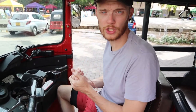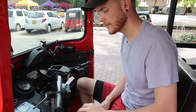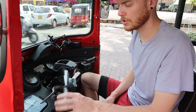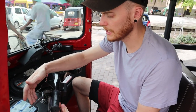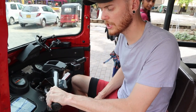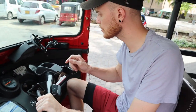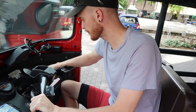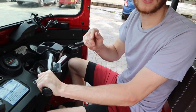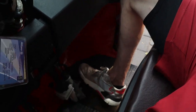Now we've got it started — you're in neutral. How to find the gears: this here is the gears and the clutch, everything is on this lever. This lever here is the clutch. Now we're going to go into first gear — pull the clutch in and click it up. Now we're in first, the neutral light will go out. Then put your foot on the brake.